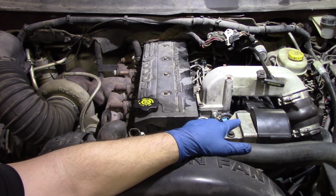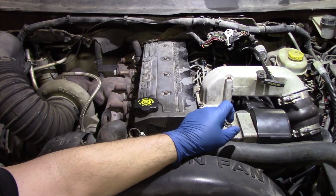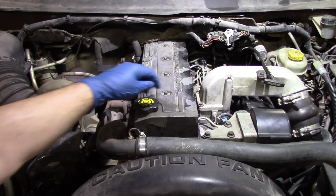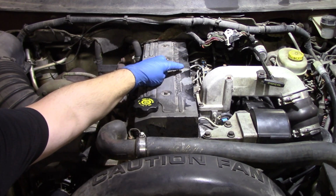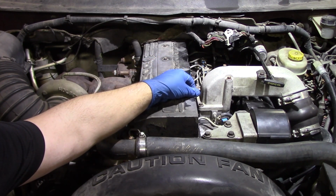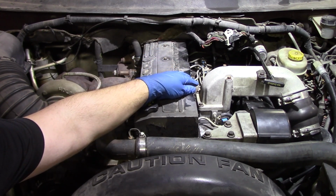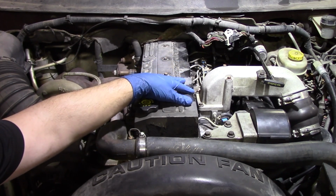On the side of the pump, where you have your fuel inlet, where the fuel is actually being delivered to the pump, you need to crack that line just a little bit. You also need to keep the number 1 cylinder, the number 3 cylinder, and the number 4 cylinder loose. You don't want to torque down that line just yet. Number 2, 5, and 6, you can go ahead and torque those down to 28 foot-pounds, but number 1, 3, and 4, leave those loose.